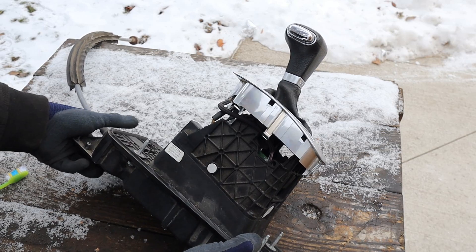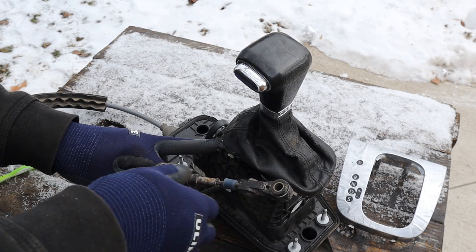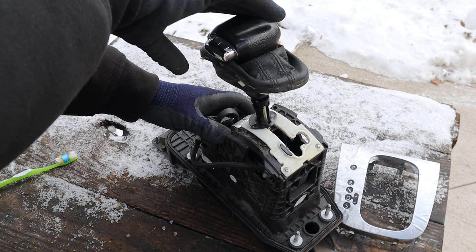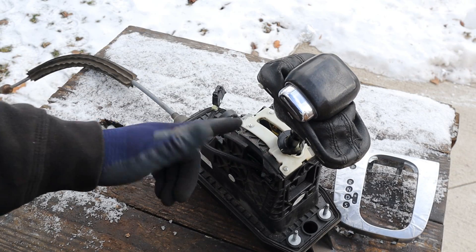The entire base here is made of plastic and actually bolts up from underneath the vehicle as opposed to in the console. The shifter has a few main functions — the first of which is to control the movement of this cable relative to the transmission so it knows what gear to put it in. And of course this also has a bunch of interlock functions to make sure you're not in the wrong gear at the wrong time. As you'll see, this is a pretty complicated system — it all has to work mechanically. This is not your typical EV digital shifter.